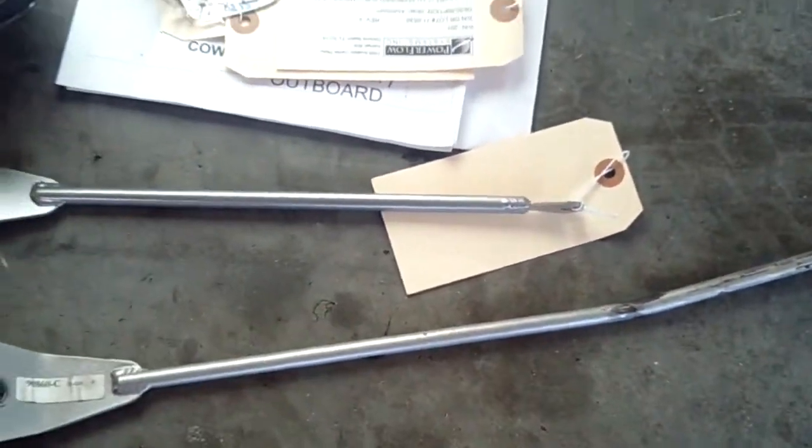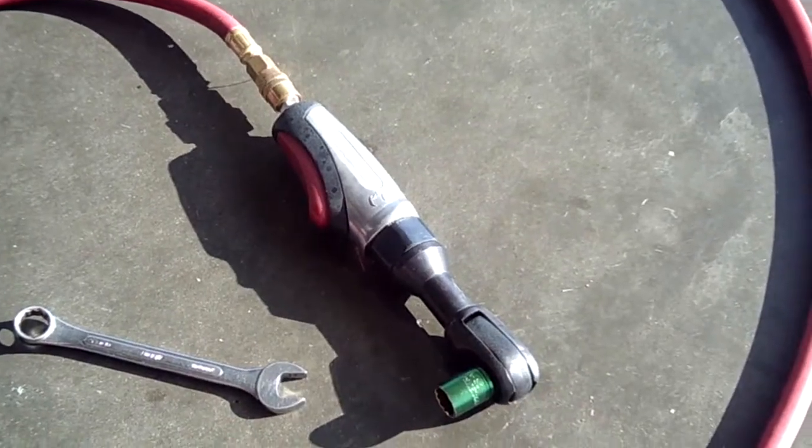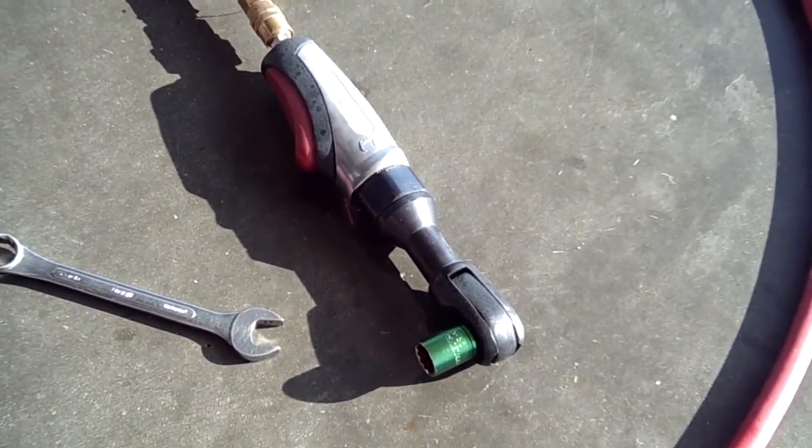We're going to remove the tack from it, put the bolt through, and put it back on the airplane. You don't have to have a 3/8-inch air ratchet, but it definitely makes doing the motor mount a lot easier. We've put the new bracket on and left it loose enough so it can actually move, because we don't know exactly how all the geometry is going to hang yet. We want to leave ourselves some wiggle room. Once it's all fixed into place, we'll come back and tighten that motor mount. We make a note of that on our checklist so we don't forget.